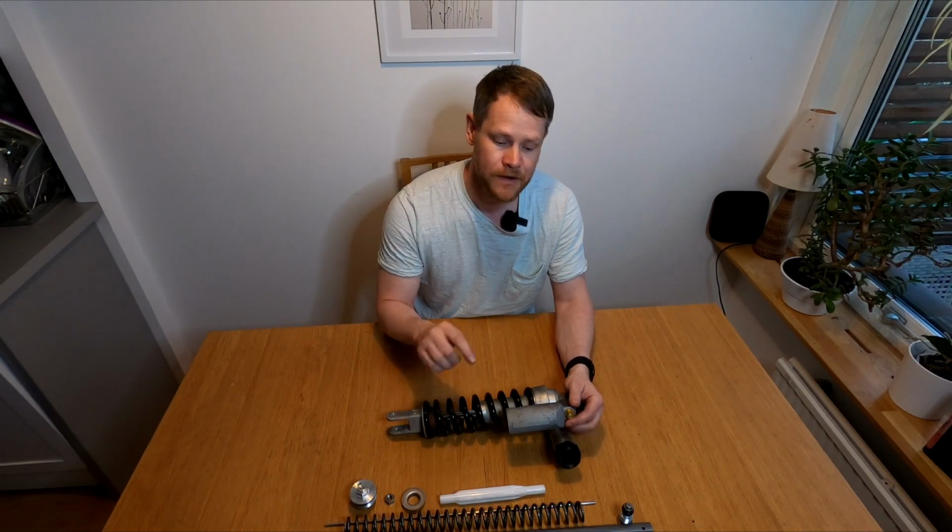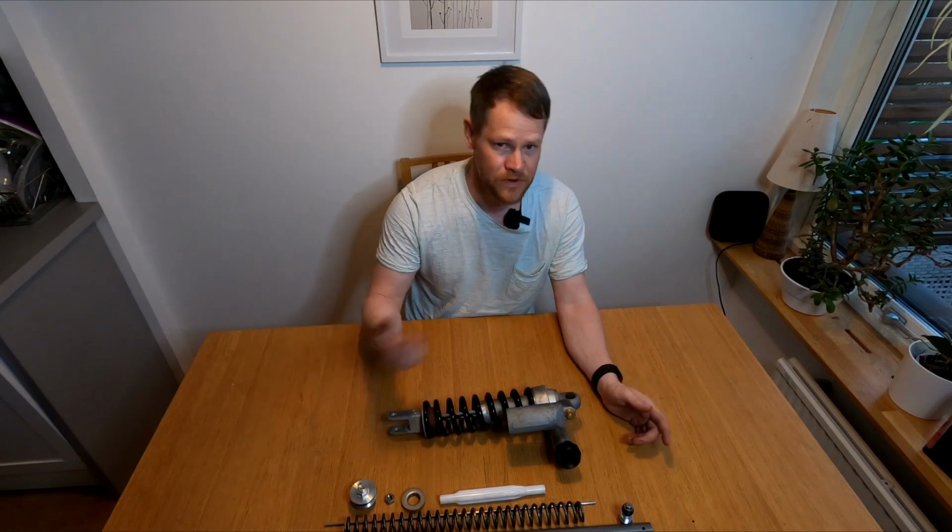But yeah, we will come more into that, and I advise you to check out Robert of Nomad Sweden. He did a little adjustment of his suspension, so you have a link up here, and you can follow his guide as well, and he felt a difference. I advise you to try this out and dial in your suspension on a known good road or track or trail somewhere where you have ridden a lot of times, and then play with your suspension, write the numbers up so you don't forget, and then try different settings and ride again and see if you can feel a difference. And that's how you really nail down your settings. But let's head out to the garage and check how you set the sag and control the sag.